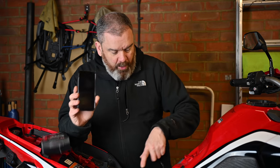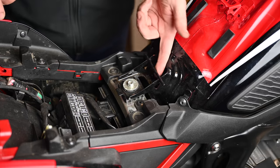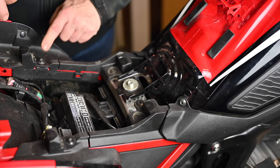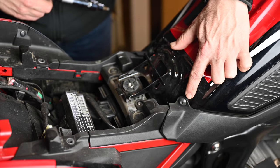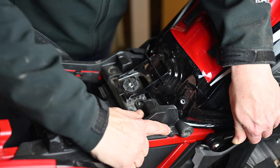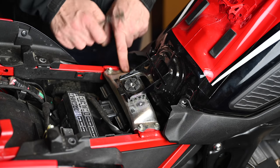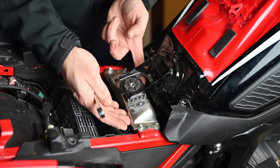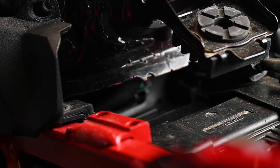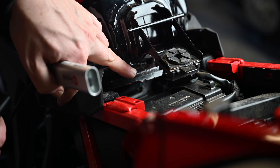Then it's a case of undoing several bolts in here to be able to lift the tank up, and that's where you can get to the IMU port which is under here - that's where the EasyCAN has to plug into. We want to be able to lift this part of the tank up, so the next thing to do is to get these two 5mm Allen bolts out, these two up here, and undo this bolt here and these two bolts here as well. Once this tab is off there are the extra two bolts to undo and these bits can be lifted away. Next is to get these four 8mm bolts out to get this bracket off - this is the tank mount bracket and underneath here is where the IMU plug is.